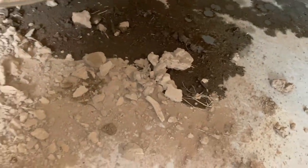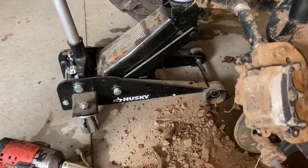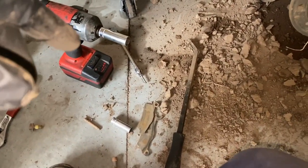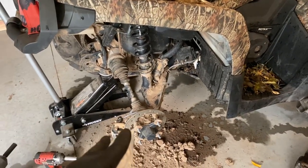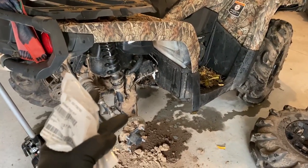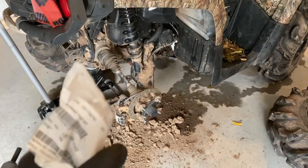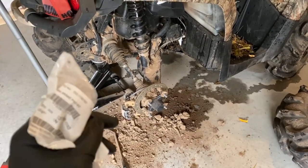Let's see what we have — metal on metal. That explains why my brake lever goes to the handlebars every time and there's a rattling noise in the back when I'm going fast. Now, double-check what side your brakes are on. In this case, since the caliper in the rear is on the right-hand side, you're going to need two sets of right-hand brakes and one set of left-hand brakes. Make sure you pay attention to that when ordering — don't order all three the same part number.